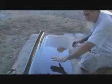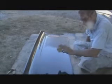They say not to quit too early on this process. I guess this compound has abrasives in it. When you start, I bear down hard, then I speed up and take off some of the pressure. Then if there's a polishing agent, like a rouge, that takes over. So they say don't quit too soon. Anyway, it's not glass, but I'm liking it much better. I can really see where they say to use that 2000.